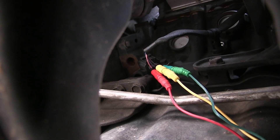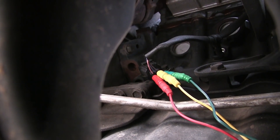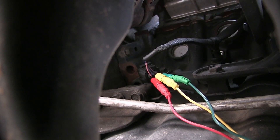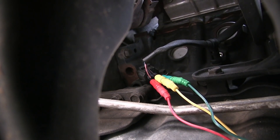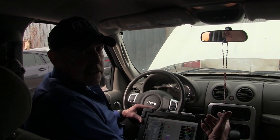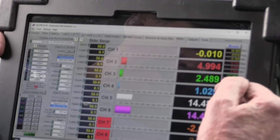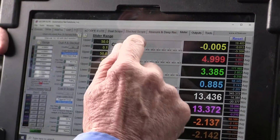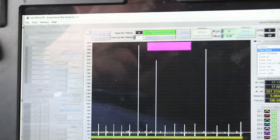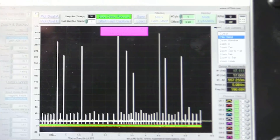I've moved the leads to the actual crank sensor because to do the voltage drop, you need to be at the connector here. So now we're at the connector. Let's go ahead and get the data from the sensor and figure out what's wrong with it. I connected the crank sensor to the scope — that's channels one, two, and three. Channel four is the cam sensor. We're connected. So there it just sort of cut out. I have no loads on it. All the electrical is shut off. I just got it to cut out again.